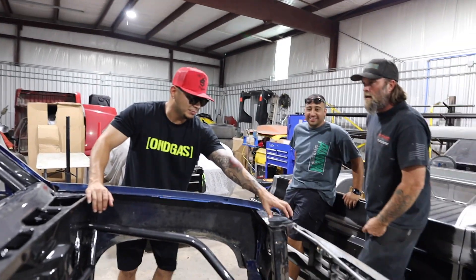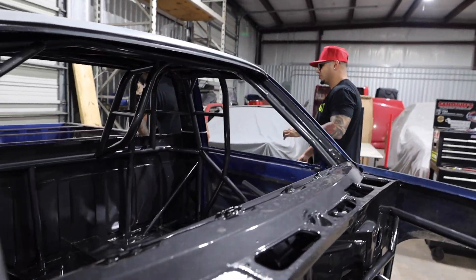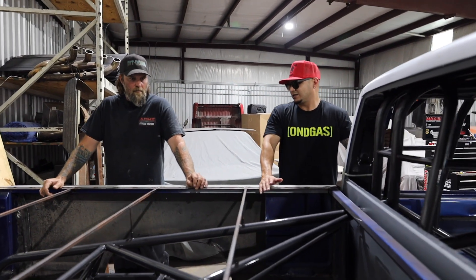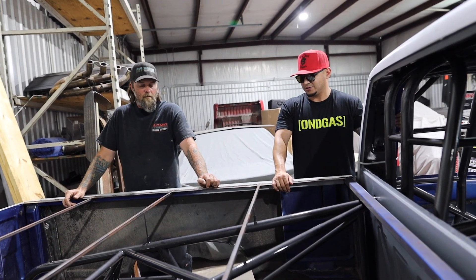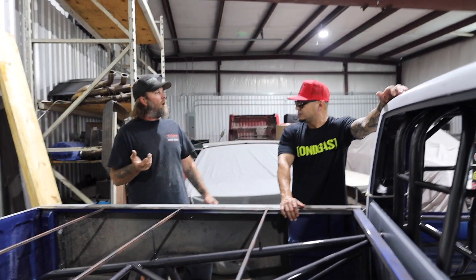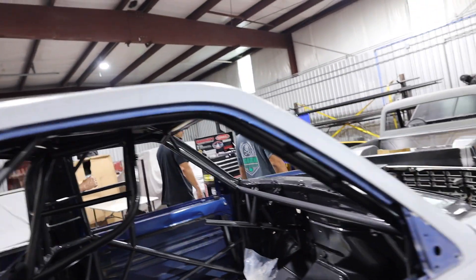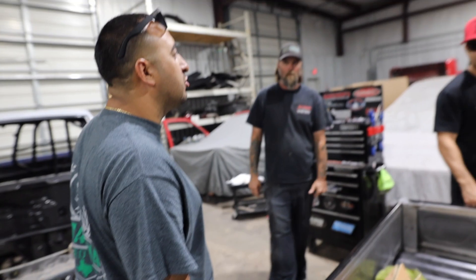So the plan is: blue on the visible exterior, black inside — all that interior gets hot rod black. Not flat black, not primer black — hot rod black. It's like the matte finish they paint on pipes for a turbo kit or headers. The difference from flat black is flat black shows fingerprints and marks easily. Hot rod black is the way to go. And this is going to be done quick — there's nothing to it. They don't even have to take much apart.